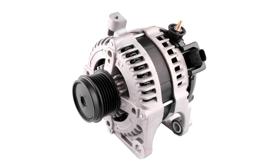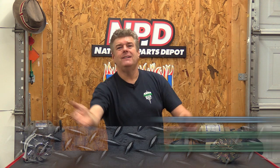From there, Chrysler moved on to the compact alternators, and these are the ones Mopar guys tend to want to look for because they can be had in 90 and 120 amp configurations. It's a pretty well-liked alternator in the Mopar hobby and mounts up to pretty much all the small and big block stuff. I don't know for sure because I'm not a Mopar guy — if somebody wants to give us a Charger or a Duster, I'll take it.